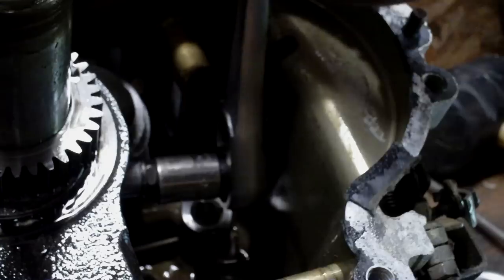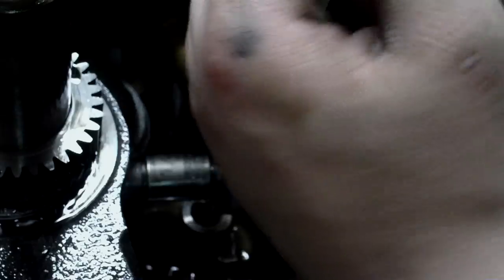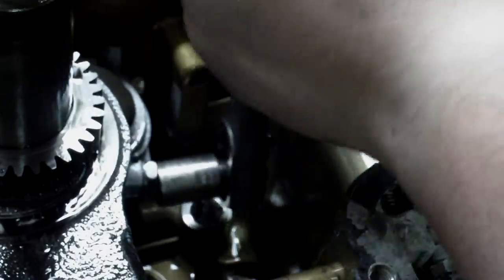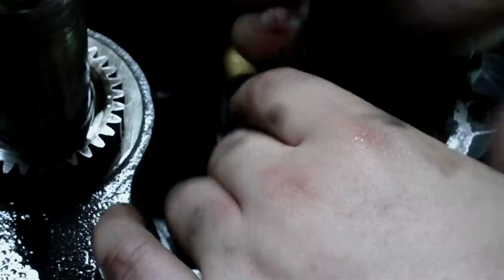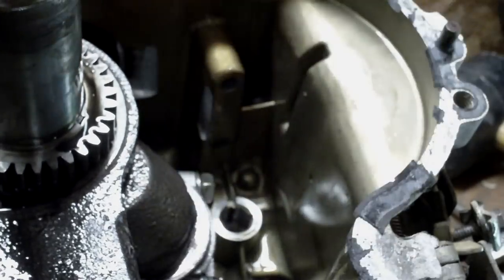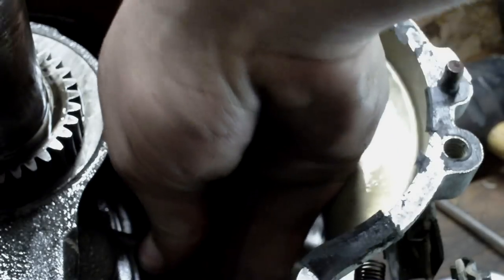This part's a little tricky, getting your ratchet in here on the bolt. It's a half inch bolt. These are pretty tight. It slips off easy because you've got oil all over it. Now to get the other one out, turn your crankshaft down like this. A lot of these engines, the thing that locks them — if they don't have it, you'll hear it sound like a rod knocking. That's what it is. But the reason is because these bolts start working loose. They don't have nothing to do with how much oil you put in or anything. They just start working loose.